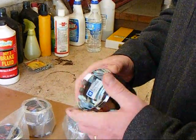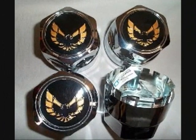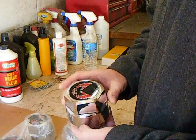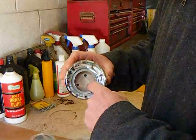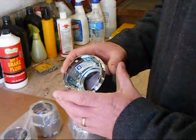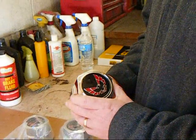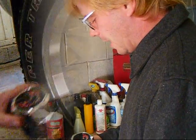This third unit, and that's what we're going to install, is the highest quality unit we can provide. It's a GM authorized reproduction with the correct bird, and if you look into this hole here you're going to see there's a metal inner liner. What this does is it puts back pressure on the factory clips and holds the unit really secure onto the rim. These are great especially if you've had your wheels remachined, because they're going to fit a lot tighter than factory and they're not going to pop off and run away on you.